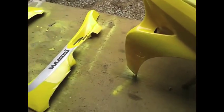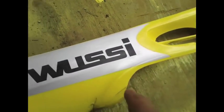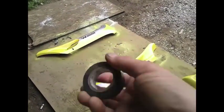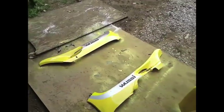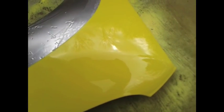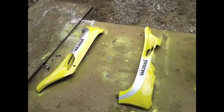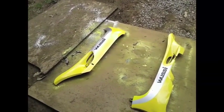I'm going to have to get some proper masking tape because what I've been using isn't right for this. I had to go in and take some paint thinner to clean all the way around there because it seeped in. I also had to clean the end up here. This stuff doesn't work well for masking — that's not its intended purpose. And I hope it doesn't mess anything up, but when I was unmasking, I had one little drop of sweat hit right on an otherwise really shiny, nice-looking surface. A drop of sweat can end up messing it up — I may have to redo the bottom of that.